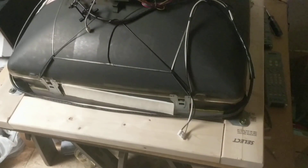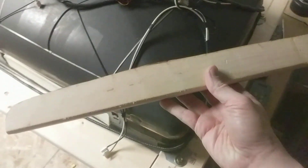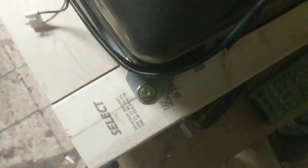Here is my project converting a Sony BBE 27-inch Trinitron monitor into an arcade monitor. I made a wood cutout all around it that will support it. As you can see here, this is one of the cutouts from one of the sides. The whole purpose of that is that those screws, originally meant to hold it into the plastic frame, are going straight into the wood.